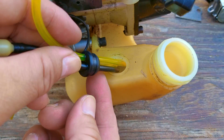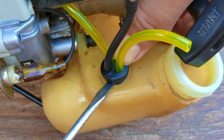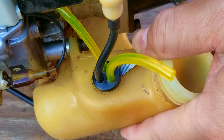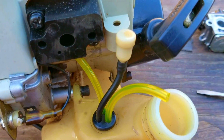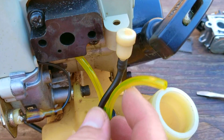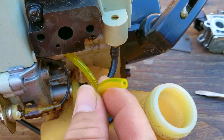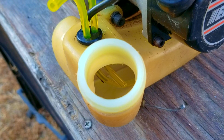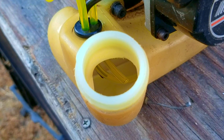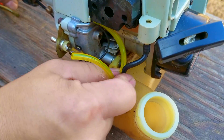Once the lines have been replaced, I'll reinstall them back in the fuel tank and reseat the fuel tank grommet. Once the fuel lines and grommet have been installed, there is a place for the tank vent to sit to protect it, so it's a good idea to make sure to place it there. One last thing before we install the carb — the fuel lines are turned opposite from how they should be on the carb, so I'm going to rotate the grommet so the lines won't have to cross each other when connected.